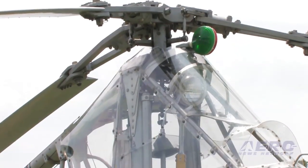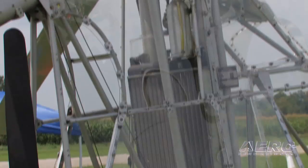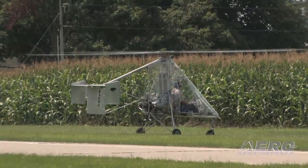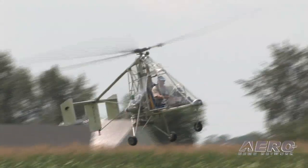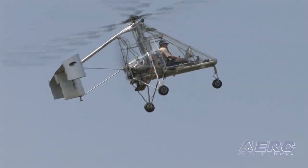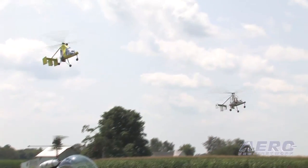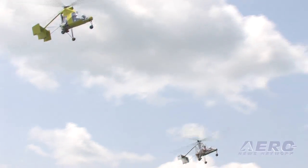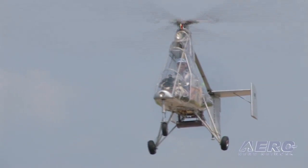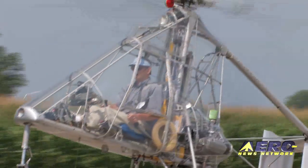Tell us about the drivetrain and what makes it unique. The drivetrain partly powers the rotor at all times, and that feature helps to give it its jump takeoff qualities. Jump takeoff meaning that wherever it's sitting, as long as there's some kind of clearance around, it'll take off from right here. I would have no problem right now taking off and climbing out very strong. So you overspeed the blades with zero pitch and then dial pitch into them to do the jump, but you also maintain some percentage of engine power to the rotors. How do you get away with that without having some kind of torque compensation? The rudder has enough authority to take care of the amount of torque that's put into the airframe.